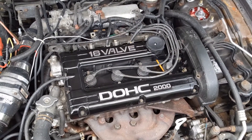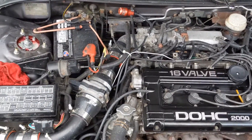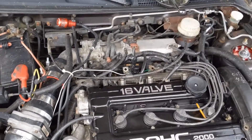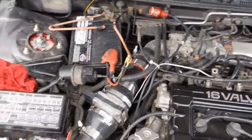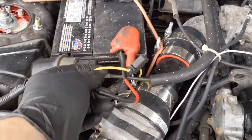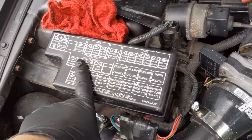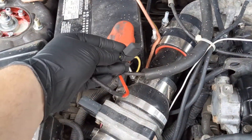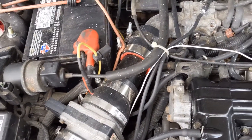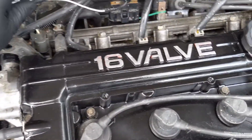If you want to see how I did the valve cover, go back and check out the episode a few back. So today's episode is the 750cc fuel injector install. First thing we're going to want to do is come over to our inline fuse that is hardwired to our fuel pump. Instead of removing the fuse from the fuse box, we're just going to pull this 30-amp out, go in the car, crank it a couple of times to use up all the leftover fuel pressure in the line so it doesn't spray gas out.